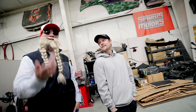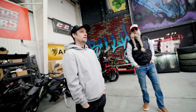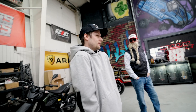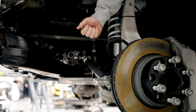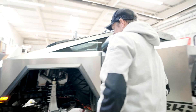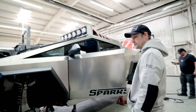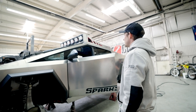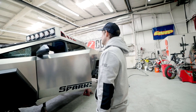They're expensive lights, but I've used Baja on a bunch of my rigs. I don't think we're going to have issues when we come into testing this next time. I think we've got all the quirky things worked out. All of our steering — we threw heim joints on there, so the front steering can't do what the rear steer did. Arms are upgraded. She's a monster now, and we can still put it back to stock. That bracket for the lights turned out super sick — it's so good. We ordered those lights and put it over like, geez those are huge. But it looks great in videos.